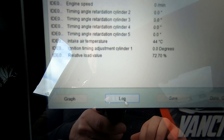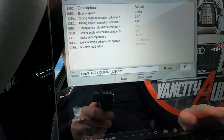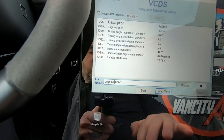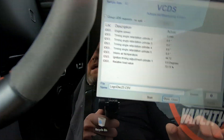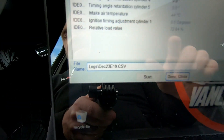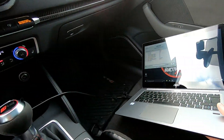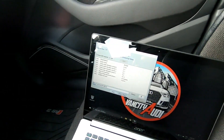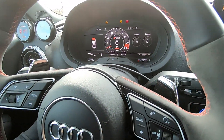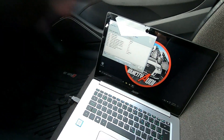Next hit Log, then name the file. I like to erase the predefined file name and name it whatever you need. Today is December 23rd, and my ethanol gauge shows E19, so I'll name it 'December 23rd E19.' Now it's ready to log. Put the laptop on your seat because it needs to stay on and running during the log. I like to run the cable back behind all your levers and gear shifts, then plug it in. So it's all plugged in and ready to go.